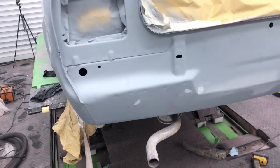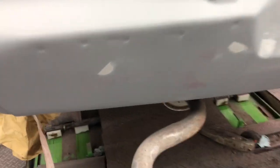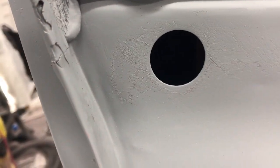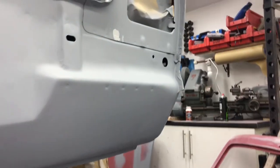The rear panel is looking okay — again, a little bit of rubbing down needed. To be fair the high build would probably cover all of that, but I'm still going to rub it back with the DA a bit. Where the number plate holes were they're all okay, but there's a little bit of stopper filler needed there. I do know that that's covered by the bumper, but while it's all off I might as well get it right.